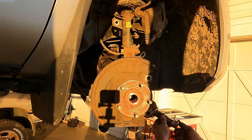Even though it wasn't an obvious failure, the belt is slipping. When you would drive it, you'd feel it jerking. And I have to think that even though the belt looked reasonably good, that was the problem. Either that or the mechanism that was tensioning those pulleys to make them be in the right position. So yeah, no smoking gun found. I think most likely the belt stretched and it was causing it to slip. Because it was slipping, it was generating metal shavings, and that was the failure.